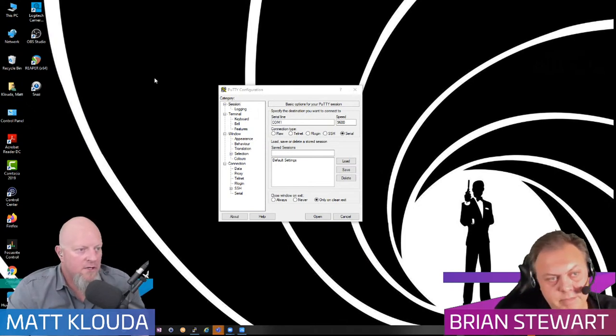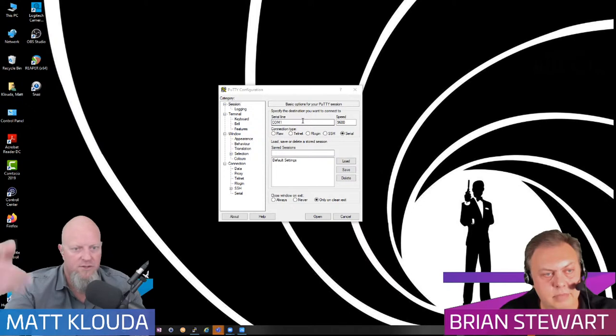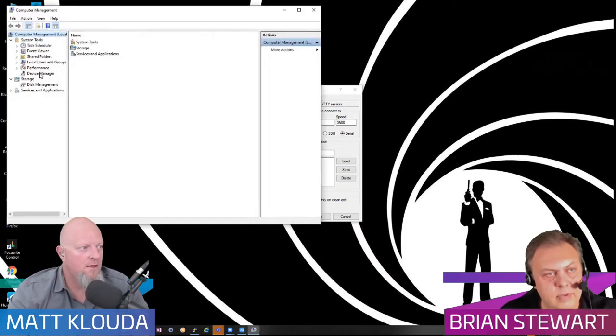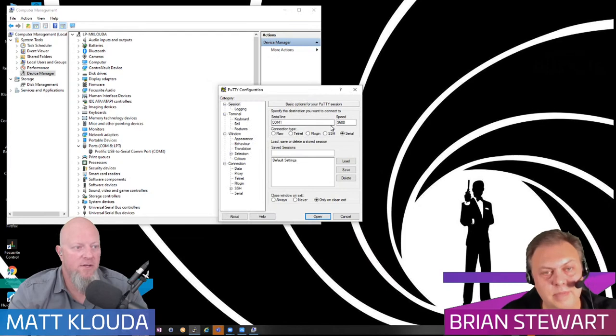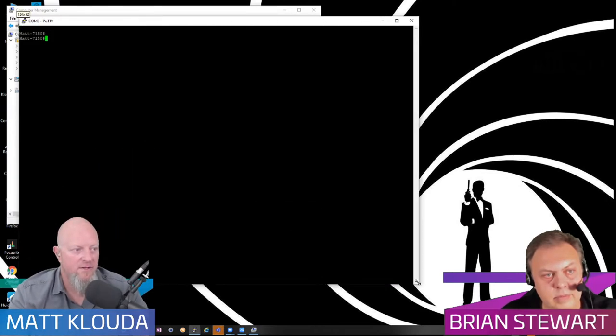So what I'm going to do to figure out which COM port it is, because COM 1 won't work. You can try and go through 1, 2, 3, 4, but that's a pain in the butt. So go to your My Computer icon, just right-click and go to Manage. Okay. And then you go to Device Manager. And inside Device Manager, you have something here called Ports, COM and LPT, which are some pretty old terms, but they work. But if I expand it, the USB to serial COM port is COM3. Okay. So that tells me if I go here and I say, all right, I need COM3, and I'm going to open it, hit Enter a couple times, and I've logged into my 7150.